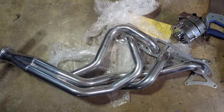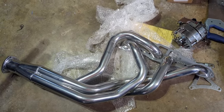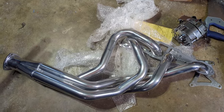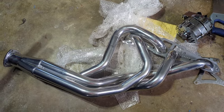This is what we went with: Summit Racing ceramic coated, 1-7/8 primary, three-inch collectors. If you get a set of these, the instructions are in with the gaskets — I didn't think there were any but there are. These install from the bottom.